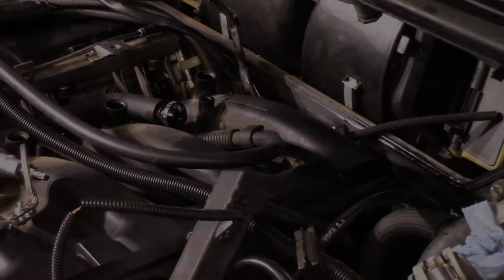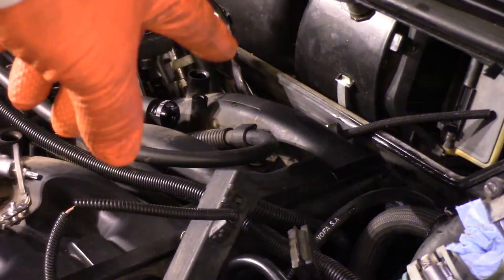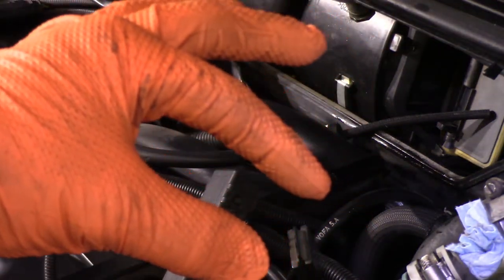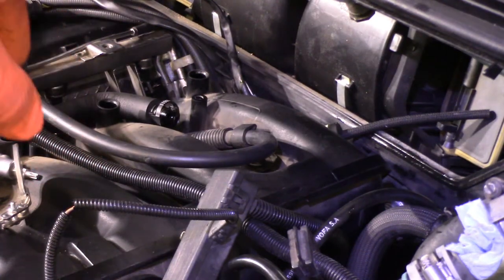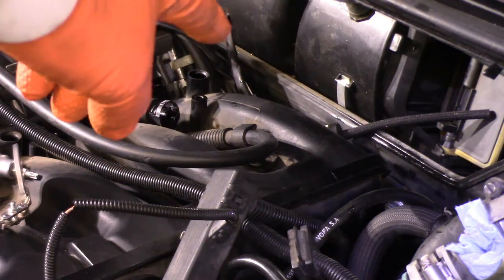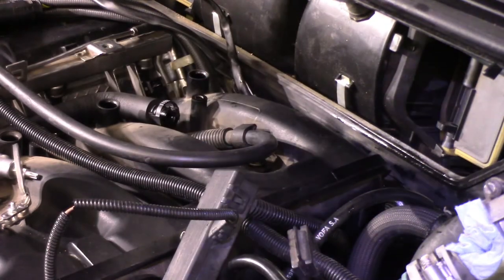After the electronic control, it comes over here to your EGR — that's right here. It comes off here, goes back and around, and both the little white and black piece and the piece over here for the EGR connect back to the EGR and hook up to a control valve that plugs into an electrical connection. My problem was the vacuum hose from the EGR over to this little control valve, which the one-way valve is also hooked into at the other end — it had cracked.